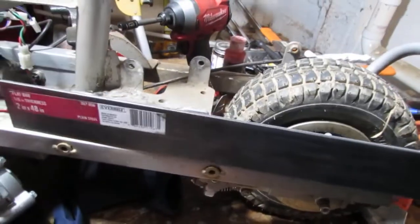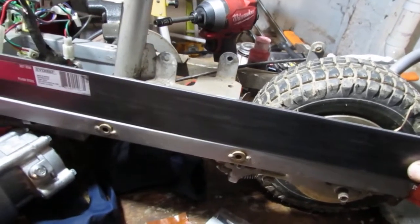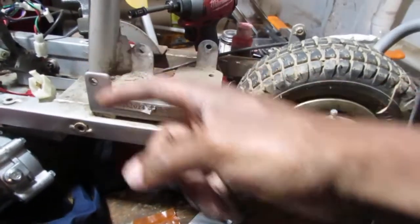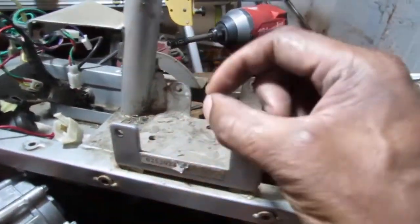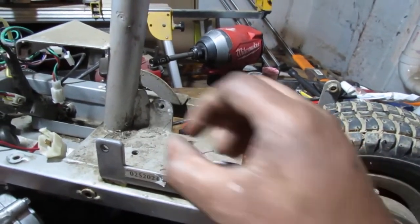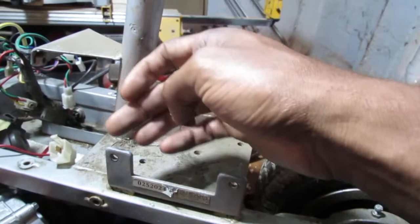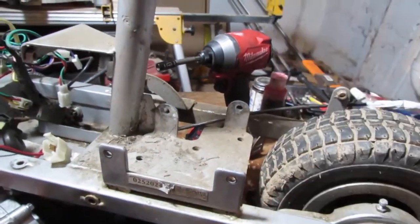But anyway, I got this piece of flat iron, and we're going to make that template. Then we're going to use a washer in between to space it just a little bit. Gonna drop down 2 holes, cut this out, and then with the offset, this should be able to slide down and bolt in through this. Cool.